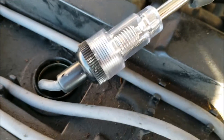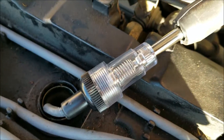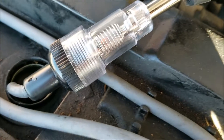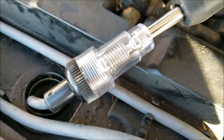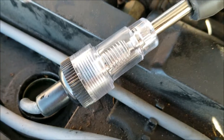As you can see, you can see that little light flashing — that's showing it is getting spark. If you were holding this with the screwdriver in it, you would see the spark jumping to some grounded bolt or something like that. As you can see, it is getting spark. Obviously it is because it's running, but if you were testing it and cranking the engine over, you should be seeing a spark in there. It might not be going as fast, but if you see anything, it'll be spark.